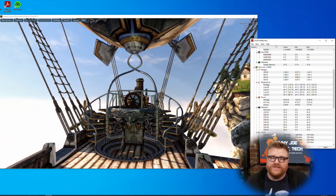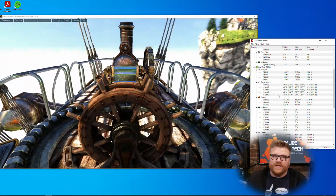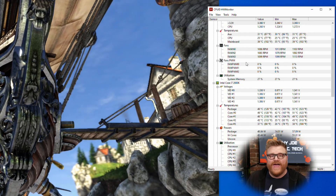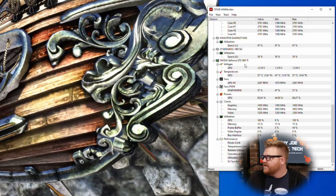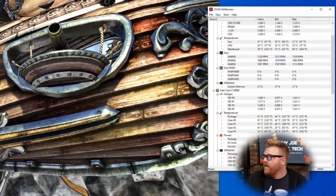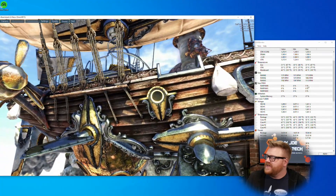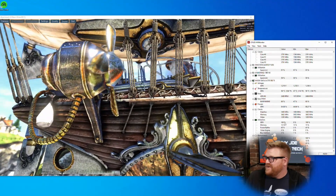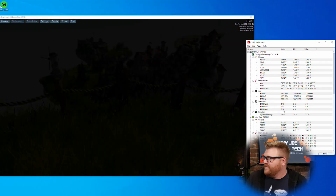He kept Hardware Monitor on the computer — I always put Hardware Monitor on the computer. I don't put HWiNFO64 because it's a complicated program; this one's super easy to read. We do see we have a 2600K as I thought, and a graphics card — 980 Ti. We're getting a nice 1080p 170 frames per second running in Unigine Heaven, and there are no issues with these temperatures whatsoever. Blowing out the graphics card might help a little bit.